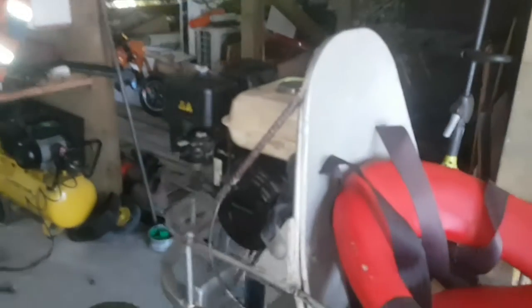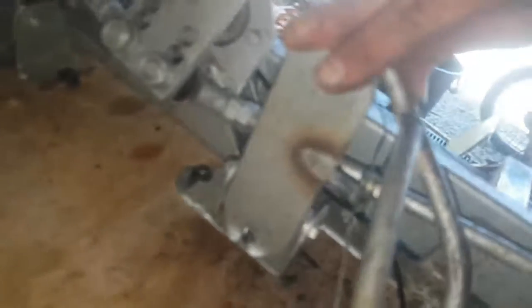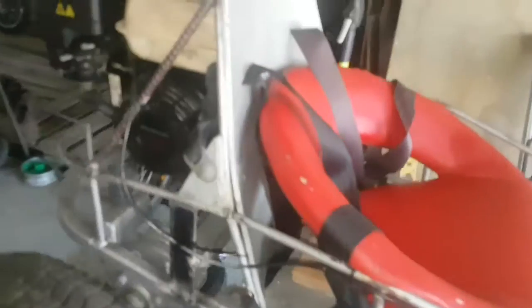It's a bit of a tricky setup, just getting the travel on the cable right and everything, but that's my new cable adjustment, cable setup. Just like the brake, it's just offset to the side, kind of hides behind this bar here so your foot doesn't contact it, but by rights it should accelerate to max throttle, and I think I've got that sorted.